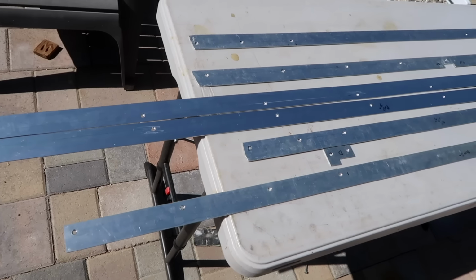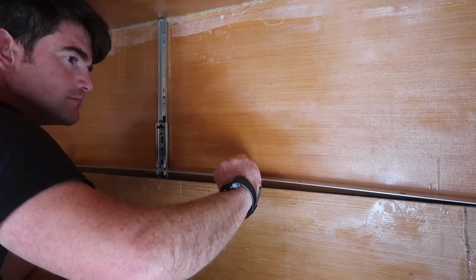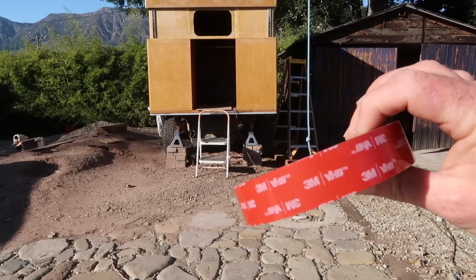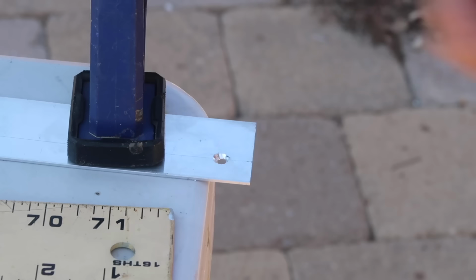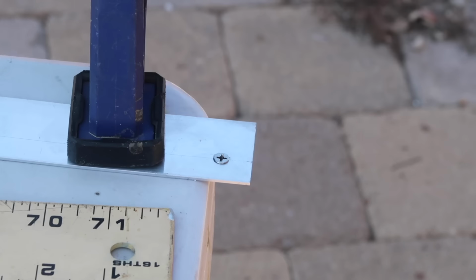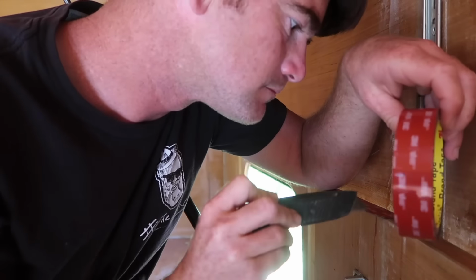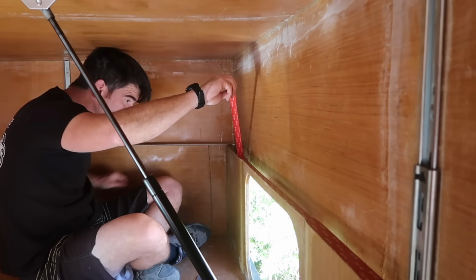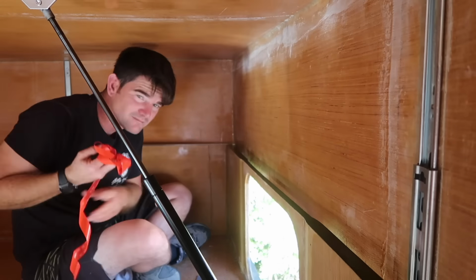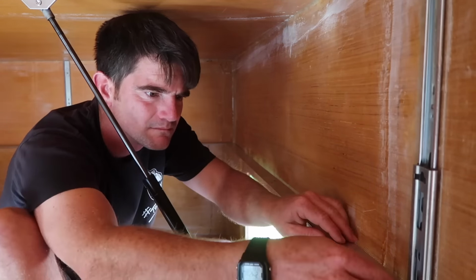Next came a cap of 1.5-inch wide, 1/16-inch thick aluminum flat bar on top of the inner camper wall. To install this, I used VHB tape and countersunk number 6 flathead screws. I didn't use the construction adhesive here like I did on the pop-up aluminum edging because it required a fair bit of cleanup once the excessive adhesive was compressed out, and I wouldn't have access to the lower outer edge of this aluminum piece. The VHB tape is a bit pricier than the caulking, but clean and easy to use.